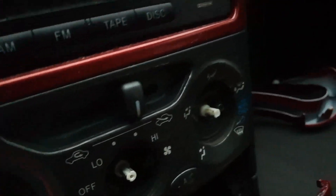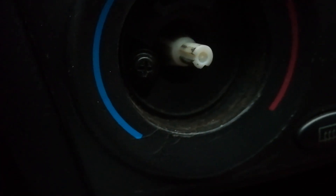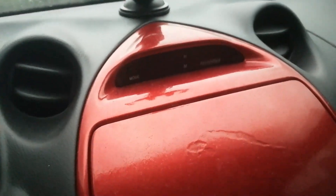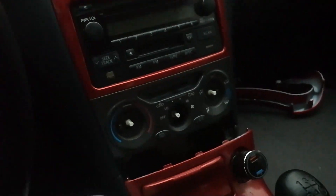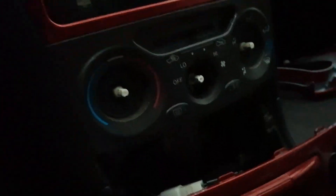Now that's out, and it turns out there are two more screws in here — one right there and one right there — that are Phillips. After we remove those we should be able to pull this out as a whole. There is a clip for the clock and a wire clip for the cigarette lighter. I just tried pulling on it and found out there are two more screws below — kind of hard to see.